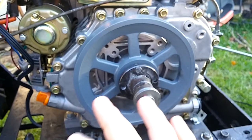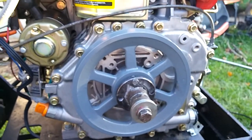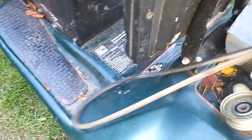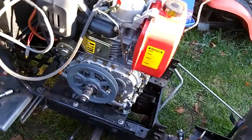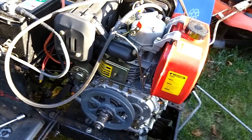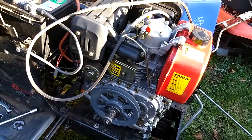When I had the 6.5 inch on here I tried it with my stock belt — it worked but it was grinding the gears way too much, so I figured I might as well upgrade my belt. The old belt is still in good shape — here it is right here. So if I ever have to go back to my stock pulley for whatever reason it won't take much to just put this belt on there, but I don't see any reason I'll have to. With that belt and the 6.5 inch it did go quite a bit faster.